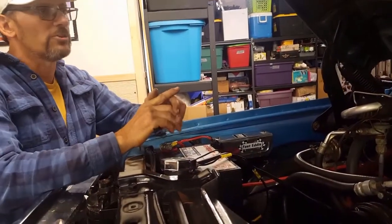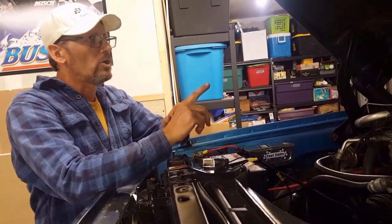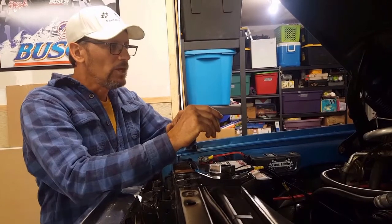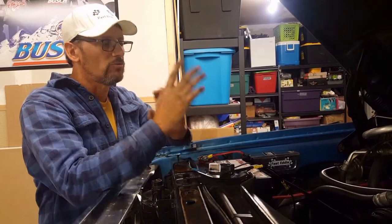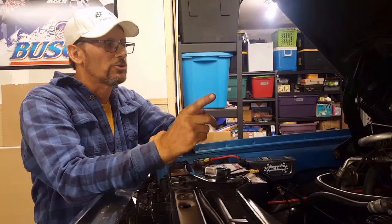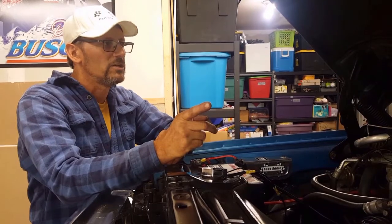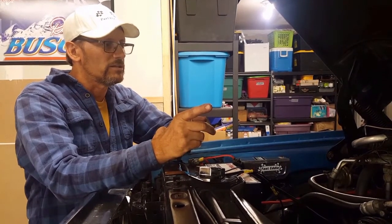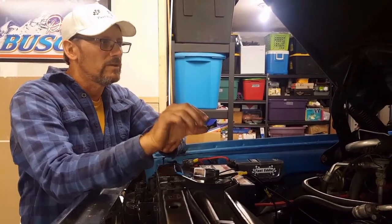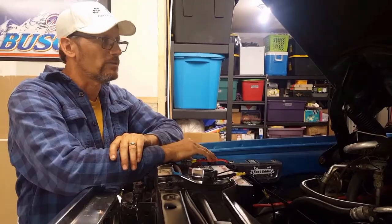Now, I will say about the wiring to the rest of the system that goes out to each side. The longer wires are for the driver's side. The shorter wires are for the passenger side. What you want to make sure that you do, so that you don't burn up the module, is that all of the wires going out to your running boards are looking for grounds. So don't get confused and think that there's a wire in there that's looking for a hot. The motors already have a plug that's already pre-wired in from the module. So the other wires, they're looking for grounds.